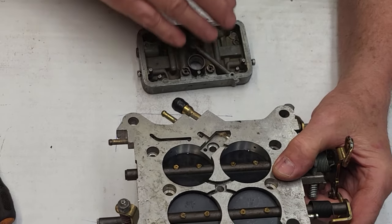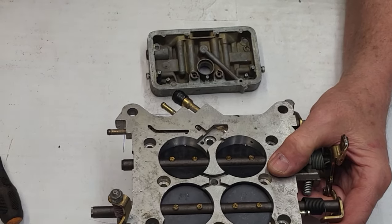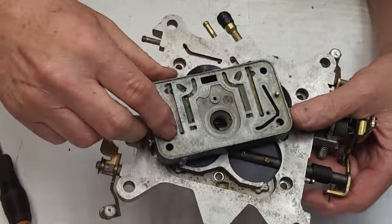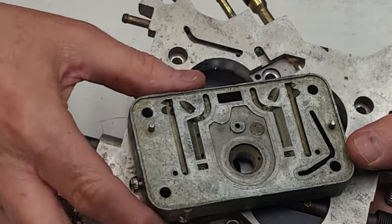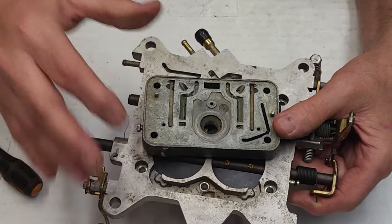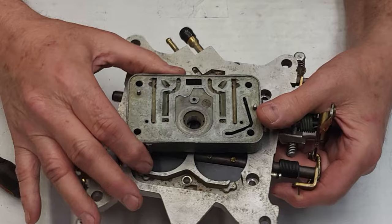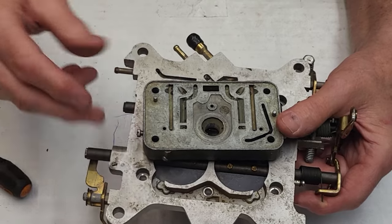That means you've got about 99% of the fuel control right here on these two mixture screws on your metering block. When we do that, we can actually set the air bleed the way we need it — it makes everything come together and gives you a good clean idle and crisp throttle response. But when you start cutting back on the idle fuel restrictors in the metering block — that little gold restrictor — you're also cutting down fuel to the transfer slot, so you're leaning down both the idle mixture and the transfer slot. That's not the way to go.